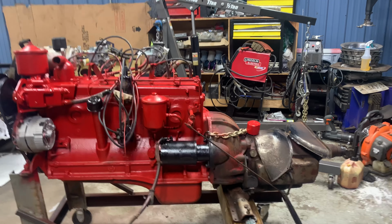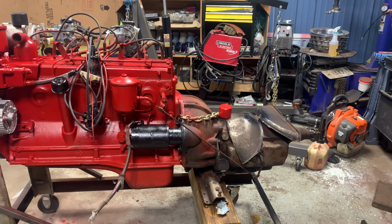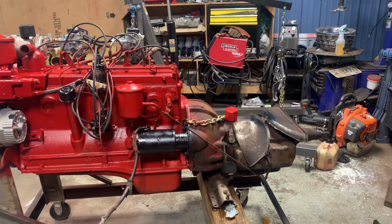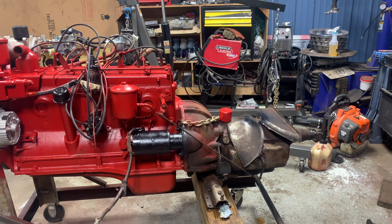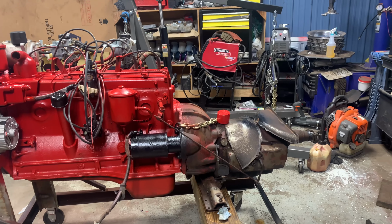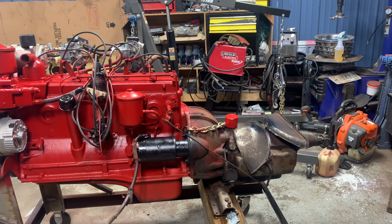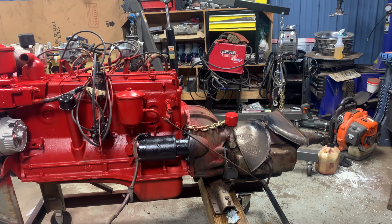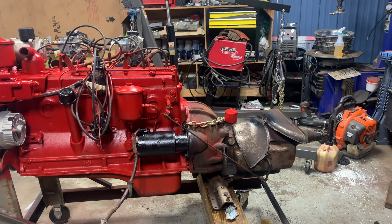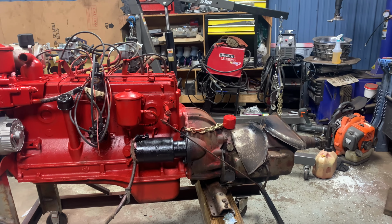And if you're driving a hydromatic with the anticipation of it being like a 2-speed Powerglide or maybe like a Turbo 350, you're gonna think something's wrong with the transmission. Ain't nothing wrong with it. That's just, I think, honestly, that's probably where the term slush-o-matic came from. But at any rate, this transmission is good, and it runs out fine. It's just its own animal.